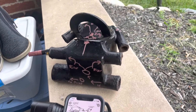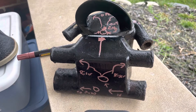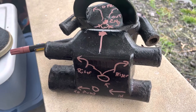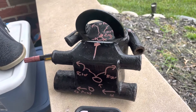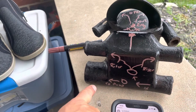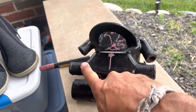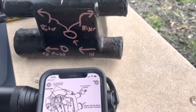I'm making this video about how water flows through a MerCruiser engine. I have a 454 7.4 liter MerCruiser. Water comes in from the impeller and goes out to the water pump or circulating pump. These two connections go to the risers, which are the elbows, and these two go to the exhaust.